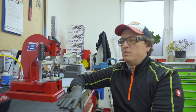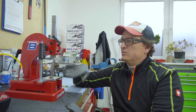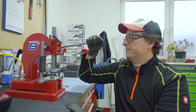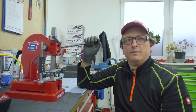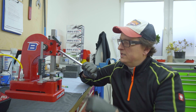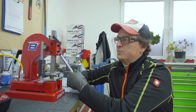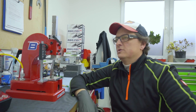That's basically it. We will make another video about maximum lift, which is also important — for example if the camshaft stroke is 12 mm, we go down to 12 mm but still need a reserve, because if the spring goes to coil bind you will break the spring and damage the engine. That will come in another video, so take care.